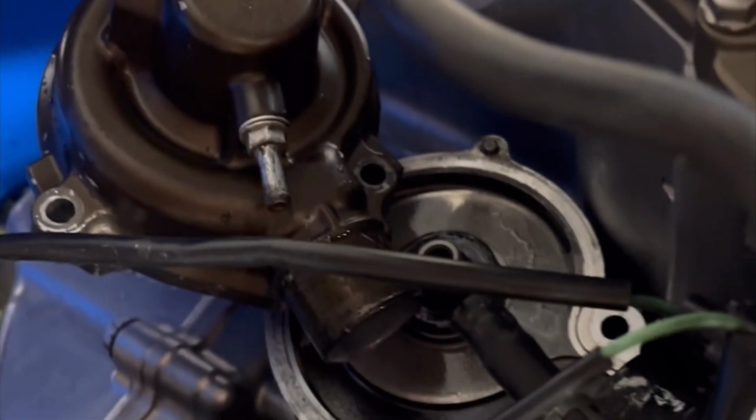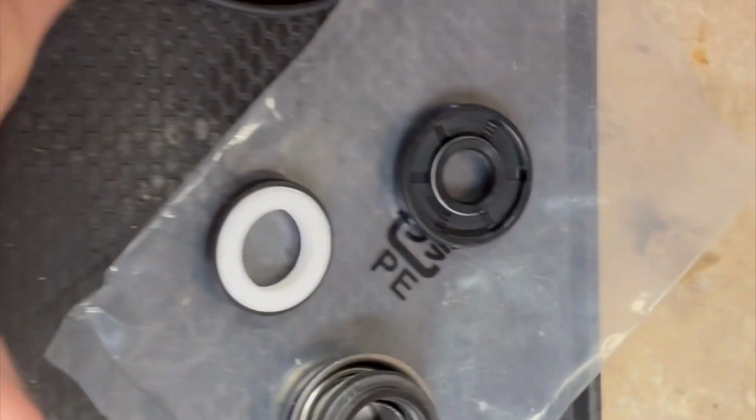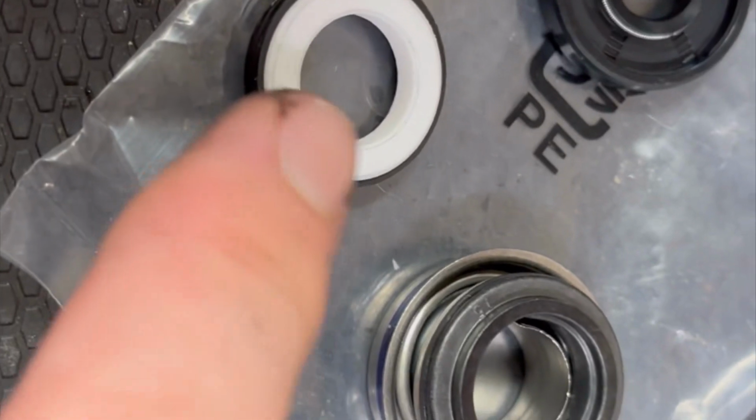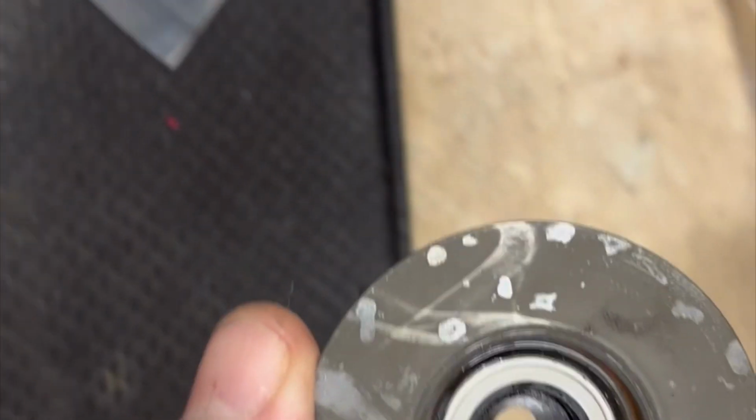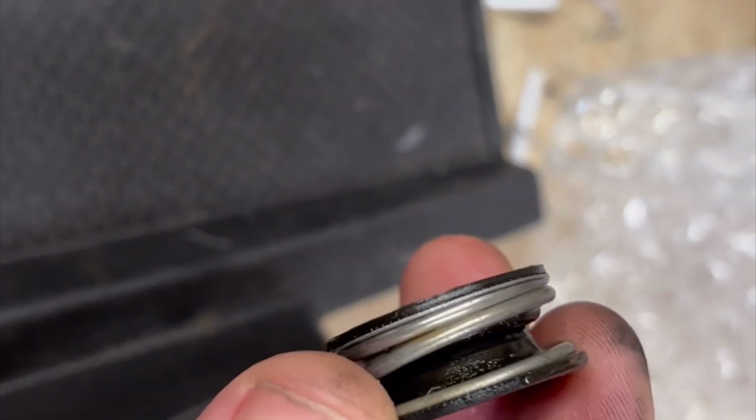to my Haynes manual and double check what other bits are on there. Give me 1 second. Okay, so this is the new kit. Obviously that's the outer gasket. This is one of the parts I found. That's the impeller that's come off. That part's on the back, so that needs to be pulled out and replaced. And then these other two, so far after the impeller came off, this part came off.